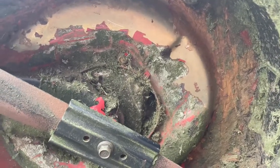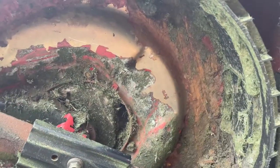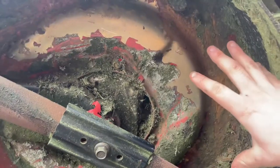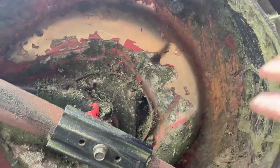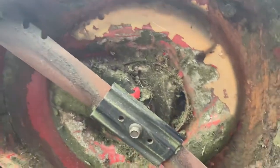This doesn't have to be perfect. I'm not going to sell this mower for a lot, but I just don't want it to rot in the next few years. This fluid film will take care of that — it'll really stay on there, and dirt and grass will attach itself to the fluid film and cause it not to rust. So we'll do a layer of paint and then fluid film all around.